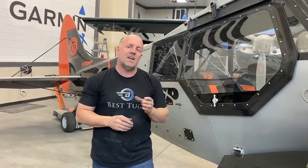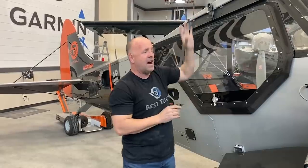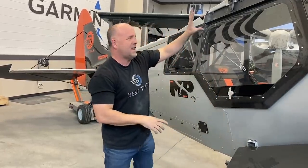It's also designed with a window material that doesn't fracture that could cause cuts. So on the top and on the front, the windows are a little harder to scratch, but they're a little more brittle on the front window and the top. But the sides are designed where they'll just bend. They don't break and cut, cause points to get cut on. So if I need to knock that window out, simply take my foot, push it through it, it'll slide out, but it won't fracture into pieces. I don't have to climb through a bunch of jagged edges. So that's the safety egress on that side.